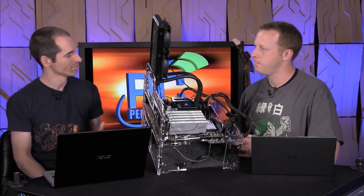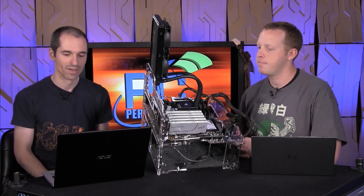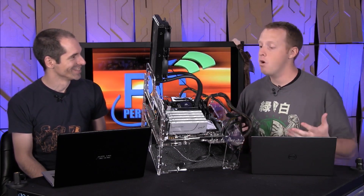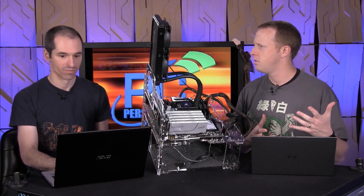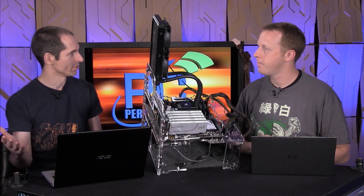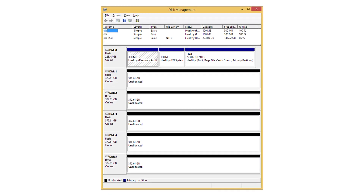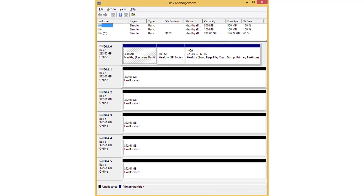So the only thing you're left with is Windows, or whatever your operating system is, to tie them together — just software RAID. That's nowhere near as optimized for fire-breathing SSDs like these. For a Windows software RAID — you just go into disk management. There's also a newer version called Storage Spaces, which is more of a Windows 8 thing. The old-school Windows software RAID disk management style was actually faster than Storage Spaces.